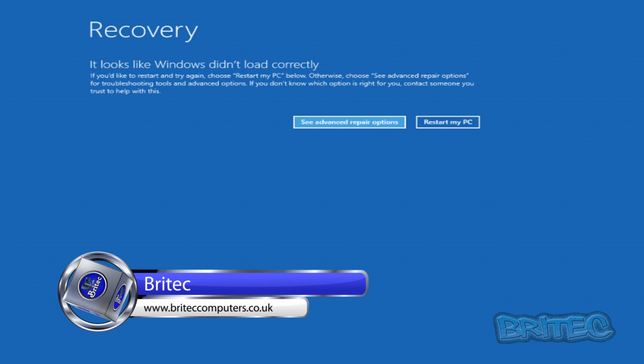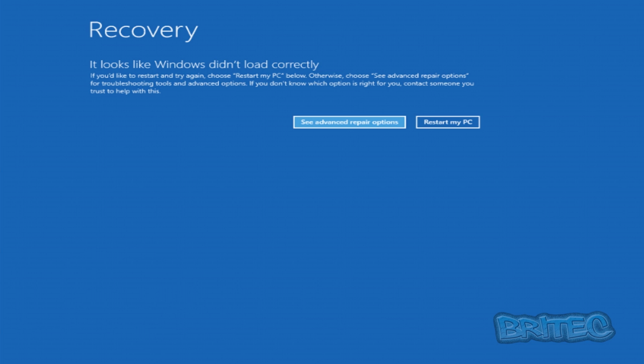In this one we're going to be looking at how we can clean up a PC that's infected with loads of viruses by using rescue CDs. Now there's numerous different types of rescue CDs, but they're very helpful at removing viruses, especially from a computer that won't boot like we have in front of us here. Sometimes the system will try to boot up and then you'll get crashes, blue screens, all sorts of messages popping up on the screen. Maybe you're getting caught up in a restarting boot loop where it just constantly restarts and it won't boot up to the desktop because of the infections that you have on that system.